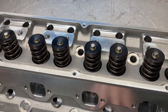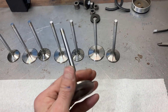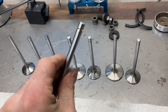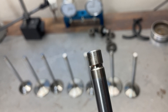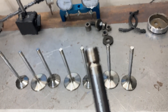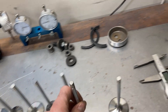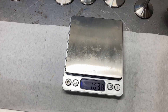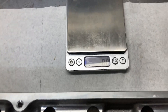I'm going to get these heads knocked apart. Here are the valves that come with these heads — these things are really light. 2.02-inch intake with an 8mm stem, with a radius groove usually only found on higher-end valves. Exhaust side is 1.6-inch, also 8mm stem. The intake valve weighs 103 grams, and the exhaust valve comes in under 100 grams. Lightweight parts — good stuff.